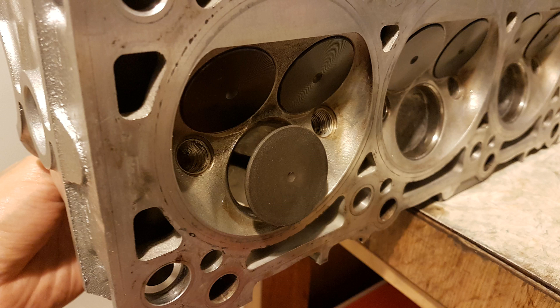After that I tested how well the valves were sitting against the valve seat. I put some grease on the valve seats — usually you're supposed to use paint but I just used grease. I put that around the valve seats and then pushed the valve down. The valve leaves a mark in the grease and you can tell how well the valve is actually touching against the valve seat.